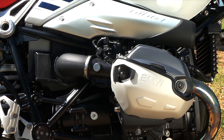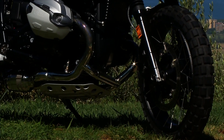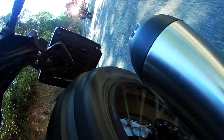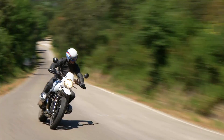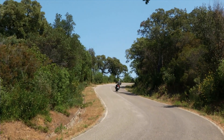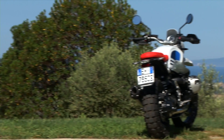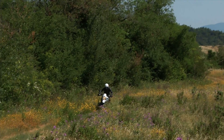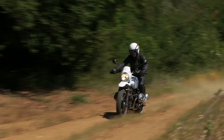This offers greater stability and precision for riders of all sizes. The air and oil-cooled boxer twin, with a central balancer shaft, is already known the world over but, like a fine wine, it seems to get better with age. It produces a peak power of 110 hp at 7,750 rpm, with a maximum torque of 116 Nm at 6,000 rpm. It offers an unmistakable, authentic design with a unique original sound — recognizable even with eyes closed.